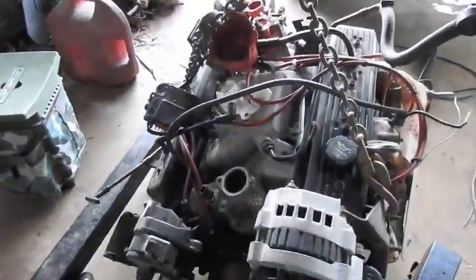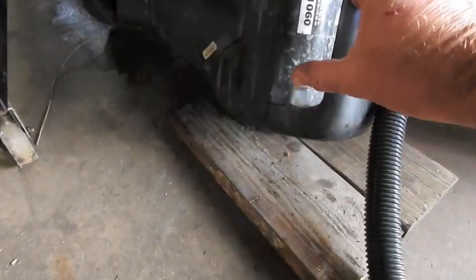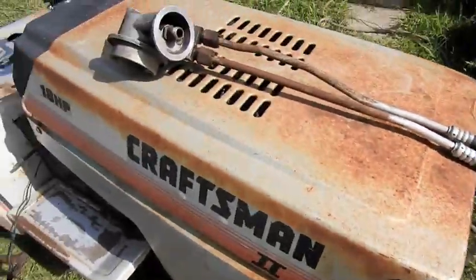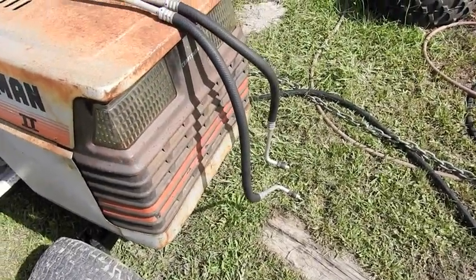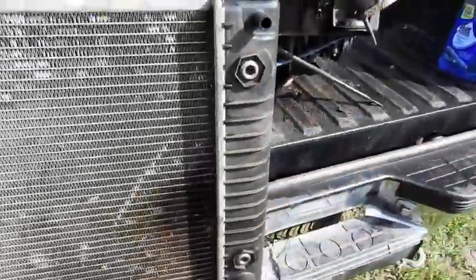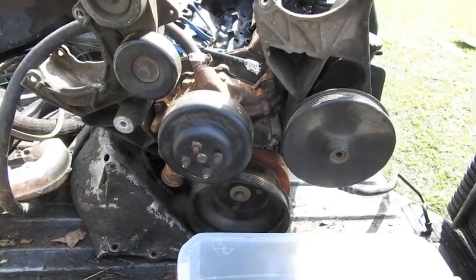Get that installed right up here. As far as oil filters go, this has a regular oil filter. I want to keep that - I'm going to buy one that's shorter. The Z71 oil cooler system - it's a 25-year-old truck - looks like a lot of potential to leak. These lines could blow out, so I'm going to delete all of this and just get a shorter oil filter. Those lines go up to the radiator. I got the radiator cleaned last night. The oil cooler goes here and I don't know what's in there, so I'm not using that. The transmission lines - I might have to risk it on those, got to have it. And there's the engine that got sand in it - I can see that being sold on Craigslist as a rebuildable core.